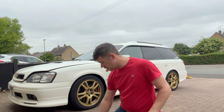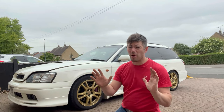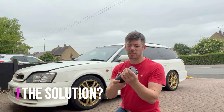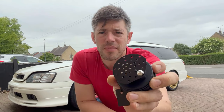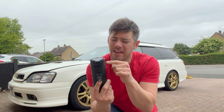To sort that out — and I know there's nothing wrong with the car because I've done about 500 miles since and it's been perfect — to sort that breathing issue out: catch can. So I've gone for a Mishimoto item, which is quite nice. You've got a bronze filter gauze just inside there, and then you've also got the baffle plate. This is the three-port one, so I've got two ins and an out, which is perfect. What I'll do is link both the heads together to go into one in on here, and then the other one will come from the crankcase, which goes through the PCV valve.